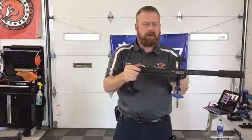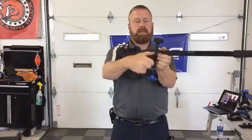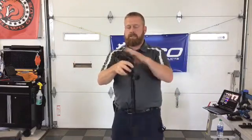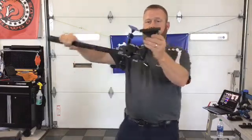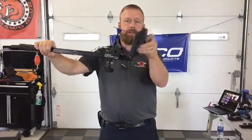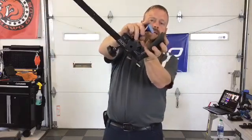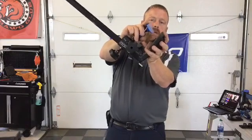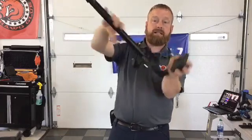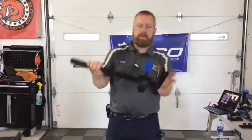Something I love about the K-bar that often gets overlooked is we can bring this all the way in, lock it in place. Now think about a rocker panel down low on the car. Instead of flat, we can now let this foot flip either way, whichever one works, and go right up into that pinch weld. And now look at how close you are able to get to your fulcrum point. Incredible amounts of power and control. This will just pull like crazy. In fact, this is a great setup when you get into those rockers where you can just lock it all together and pull. Incredible, incredible tool.